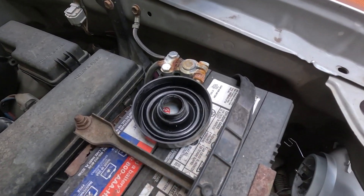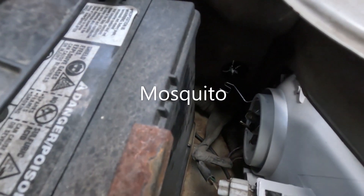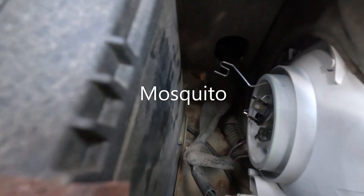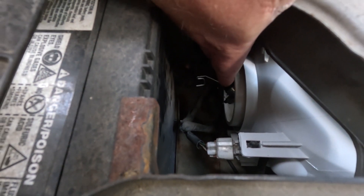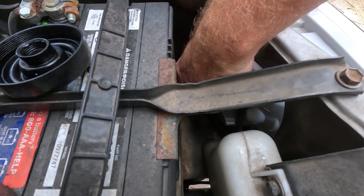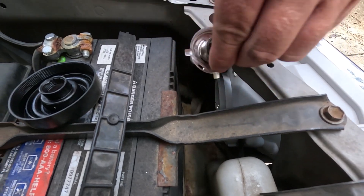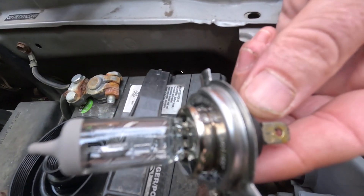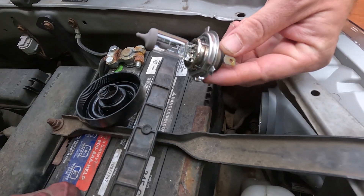First you're going to take off your dust cap right there. Then you can look down in here and you unplug them through that holding wire frame — pull it down and out of the way. Then the bulb will just come on out. And there's the old halogen bulb — that is your low beam and high beam in the Tundra. So we got that one out.